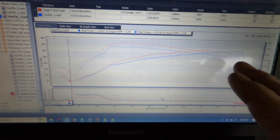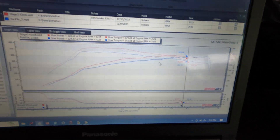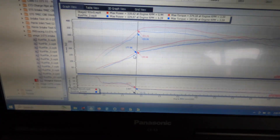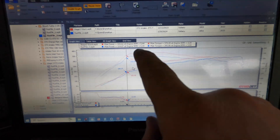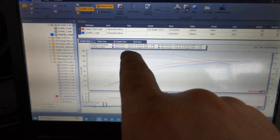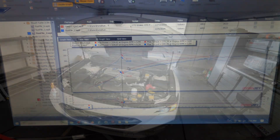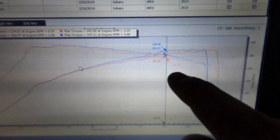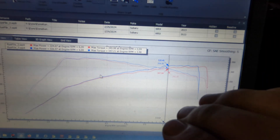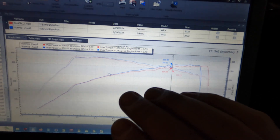This was a 16-pound pull, and you can see past about 5800 RPM we're climbing — whereas before I had to let off because it wasn't making power. Spool-up is really really close to the same. We're down a hair on power below 3000, but that previous run was at 19 pounds and we're only at 16, so we're looking good. Cam timing update — that's 13 horsepower right there just from changing cam timing at 16 pounds. It picked up a lot of mid-range, so now we can use all of the boost to maximum potential.